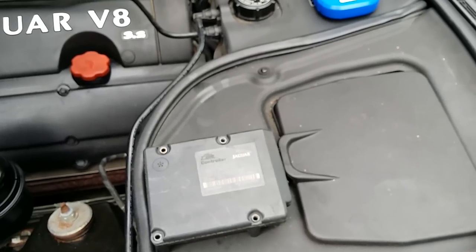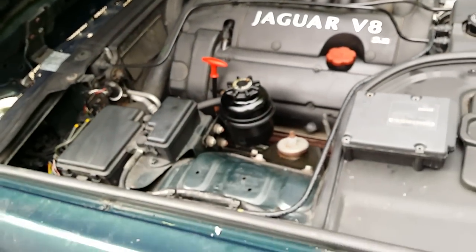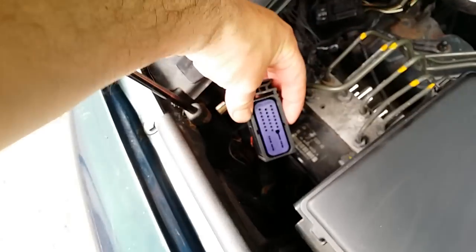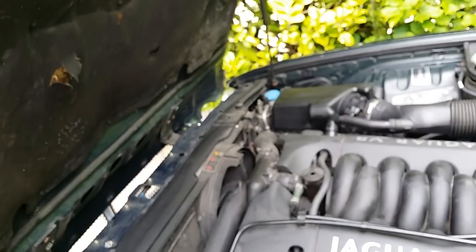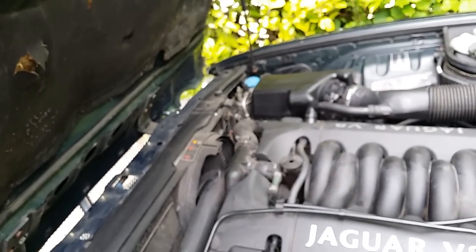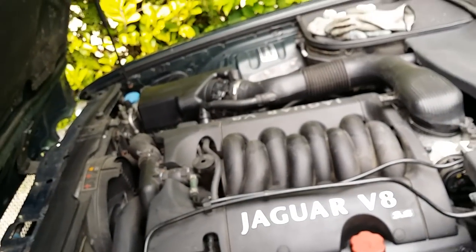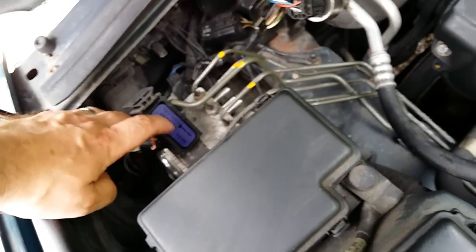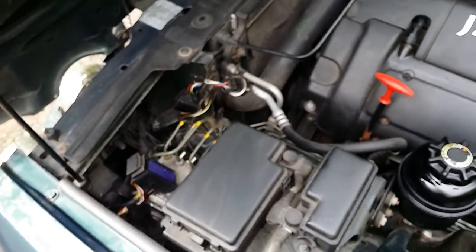I thought firstly I will trace out all the wiring, so I took the wheels off one by one on each corner. I disconnected the connectors from the ABS sensors from each sensor and checked the wiring out to the multicore plug here. You can find the wiring diagram for this online and work out which pin is for which sensor. To do this I got a 9V radio battery and put some DC power up the cable from the sensor end. Then with a little continuity tester — one of those little screwdriver things with a light on — I was able to confirm that each of those circuits was working fine on the multicore plug. So I eliminated any wiring problems from the sensors, because that can be an issue; sometimes they go faulty in open circuit and can cause all sorts of problems.